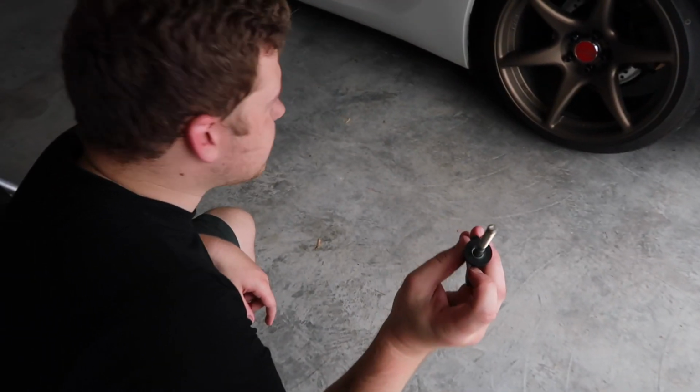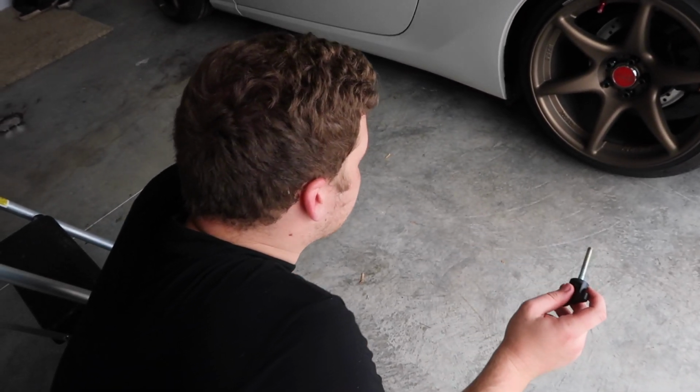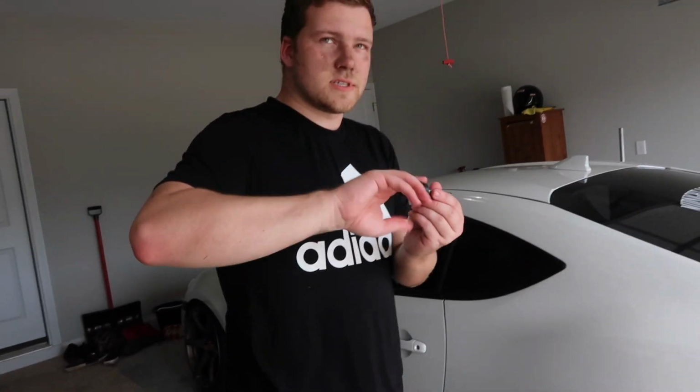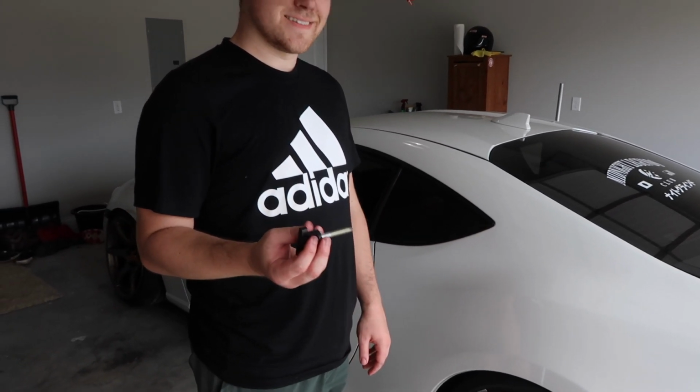What's that? It comes in the spare tire kit and stuff. Yeah. It is a rotor spreader. So basically, when you take this off, there's two little holes this size on the rotor, and you put this in and twist it, and it pushes the rotor off, and beat it with a hammer. So you thread that in, so it pushes against the hub. That's cool. I didn't know that. Don't have one of those in my car.